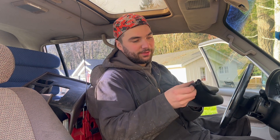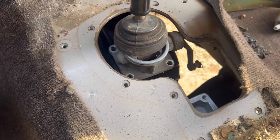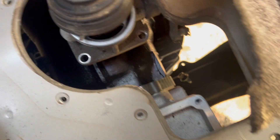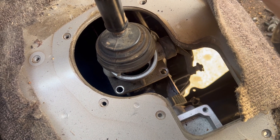What I'm going to do is build a plate that shifts the whole thing forward, so I don't have to mess with my shifter. I want the center console to be factory and in the factory spot. I spent an hour making a nice new shifter boot because I destroyed the old one, and I really want to use it. I'm going to measure the distance to the holes lengthwise and how far over, then build a little adapter plate to do that.